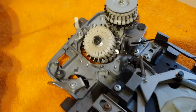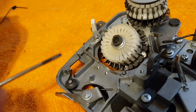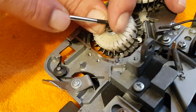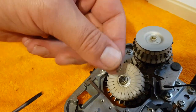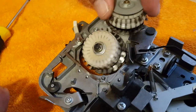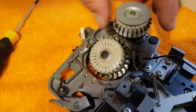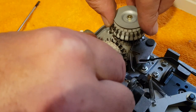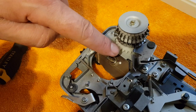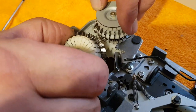You don't need to mess with any of this other hardware. There's one circlip on top of the sub drum — remove that and put it to one side. The best way I've found is to make sure those pins there are down, and then remove the sub drum. Make sure those pins are pushed in so you can just pull the sub drum right out. As you can see, the main drum is perfectly fine.